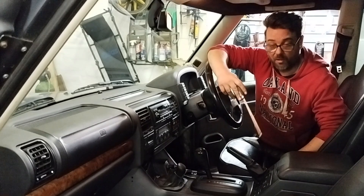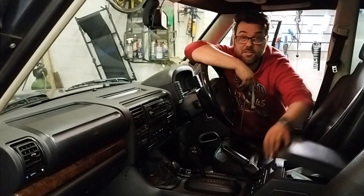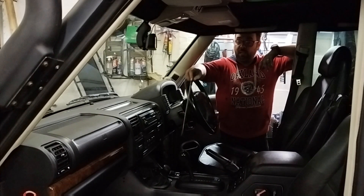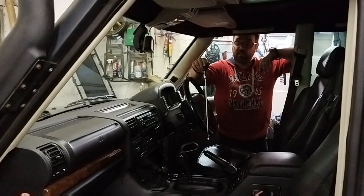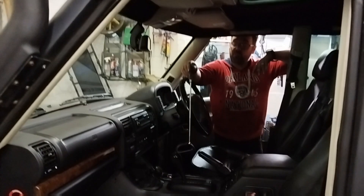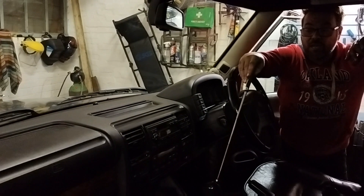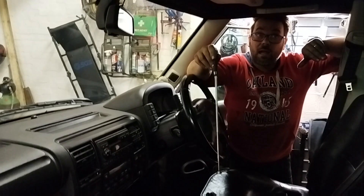This is the top model with the Harman Kardon stereo and heated seats. The driver's seat heated element tends not to work — the elements get broken inside the seat. Check your armrests are still attached. For automatics, start the car and go through the gears — make sure it's not clunky or jumping when you select gears. With manuals, make sure the clutch feels good, but also listen for a squealing noise. If they squeal, somebody's probably changed the clutch but not changed the input shaft bearing on the gearbox. If it makes that noise, the gearbox has to come off.